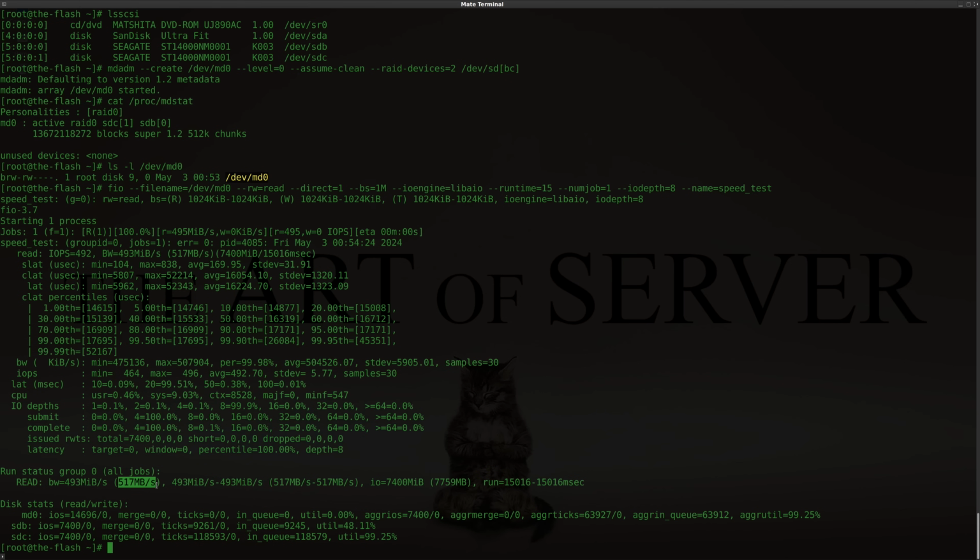This is double that. For the longest time, you could connect a modern SAS3 hard drive on a SAS1 controller and you would see no performance difference, because they just can't achieve that kind of throughput. But this Mach.2 actually can. I mean, this is getting very close to the limit of 6 gigabit SAS2, right? And this is a SAS3 drive, so it can go up to 12 gigabit, but I doubt it's going to get anything close to that. But this is at least very close to the limit of SAS2. So that's actually kind of cool.